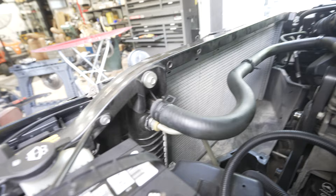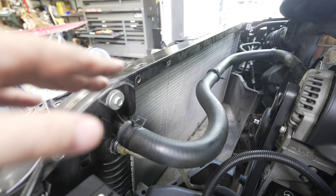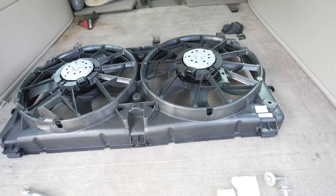This means you have the 34-inch radiator, which I do — I have the upgraded radiator. I'm not sure if it's in all the Escalades. So I wouldn't have to do a radiator flush, drain the fluid, put the new radiator — none of that. All I have to do is slip the fans in, wire it in with the Nelson Performance harness, which I'll show you, and then program it with the ECU. You're going to need these fans as well.